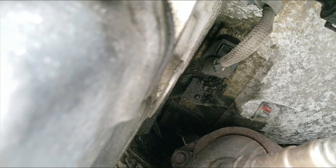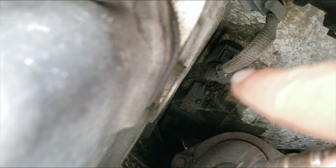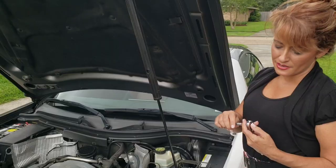It's pretty amazing — this car does not have a heat shield for its crankshaft position sensor. It might be why it went bad, I don't know, but there should be a heat shield right over in here. And there's none here. I guess someone had removed it at some point.